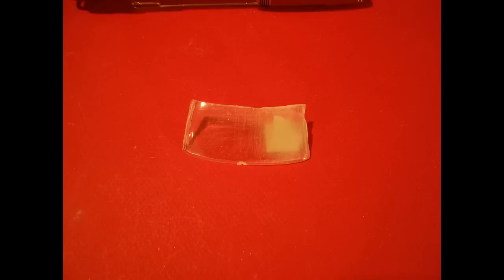I began to clean up the windshield — I started sanding that scratch that was on the right side. If you use successive grits of sandpaper right up to about 12,000 grit, you can actually polish out and clean up this plastic glass, so to speak, and make it look fairly presentable. After that I dipped it in some Future floor polish, let it wick off and dry, and it looks pretty good.